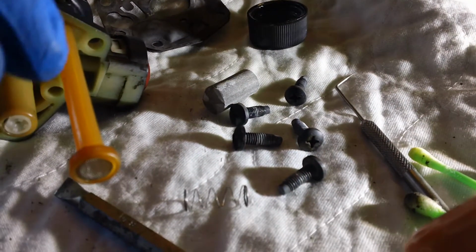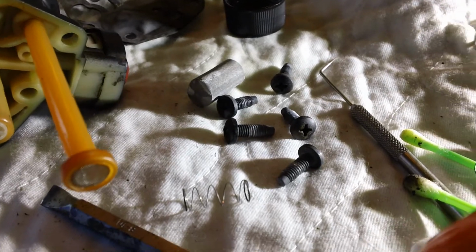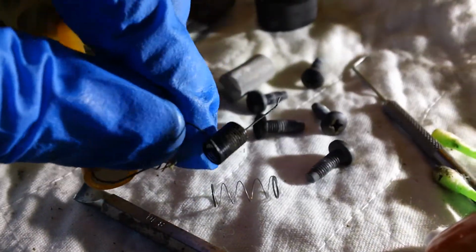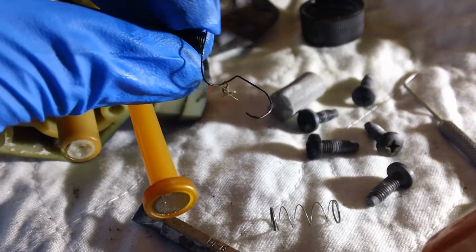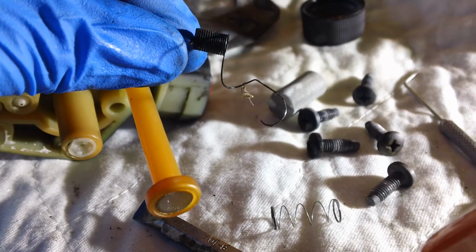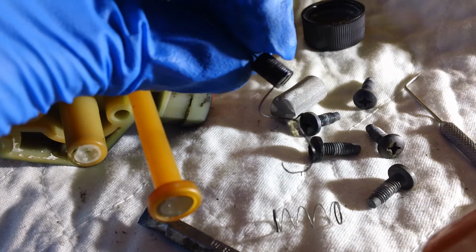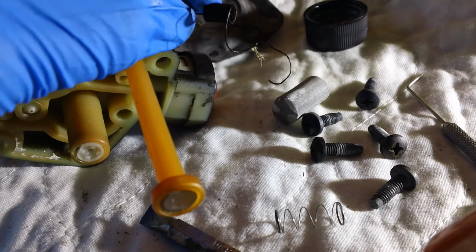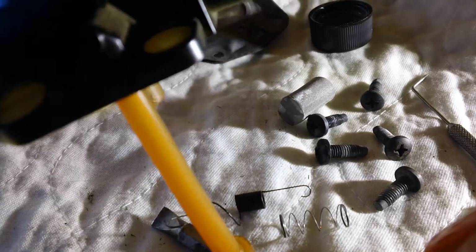I really think it was that spring that I bumped into something. If I can find it, there it is. So check this little tension spring that goes on there, because it can cause all sorts of strange issues. You might think your engine's bad or something like that, and it just needs that spring. I've got to snip that off, put some tension on there and reconnect it. And so that is the small one, that small hole.